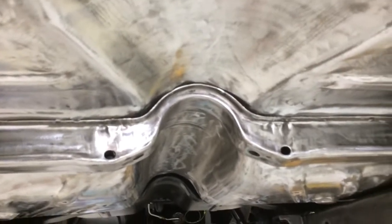You can see it's got some scratches — a nice tooth for the paint to adhere to. I'm going to leave that just like that, clean it but not make it any smoother. I'm not as concerned under here about a real smooth finish as I am about one that sticks on there real good. On Monday I'm going to the paint supplier and I'm going to get whatever primer I need to do this nice clean bare metal. Some of these new products say you don't need to prime them, but I don't put much faith in that. I like to put some primer under it first, then get whatever's appropriate primer for this finish and do a coat of primer first.